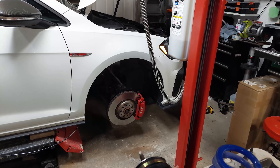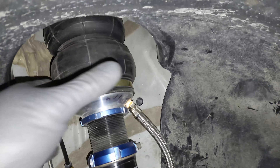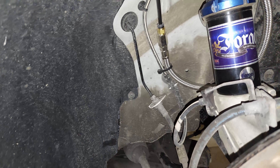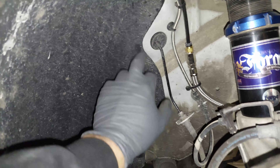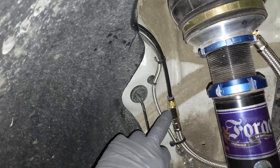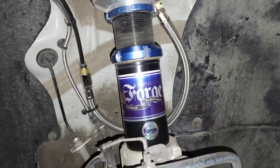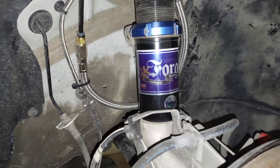We're going to put it up in the front. The GTI struts are basically back in — the rear is already inflated. So this is how I routed the lines. Here are the bags. We're running a ladder line that goes around here, in continuation with the previous videos on how to run the lines. It goes underneath here and then behind the shield, loops around here, and then goes into the ladder line really nice and clean. That allows it to have a nice little loop for going up and down and movement, so there are definitely no issues.